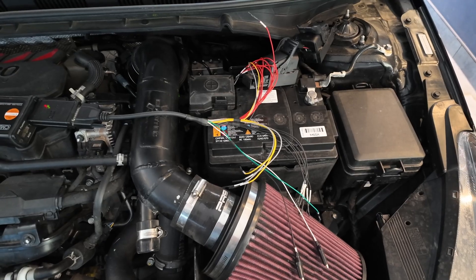The thing about this ECU is that it's quite similar to a Fiesta ST 180 but it's not identical — there are still a lot of things in totally different areas to what a Fiesta ST would be. It's actually a totally different ECU as well, but the actual structure itself is quite similar. I think there are things missing from the definition file I've got, which isn't ideal — I'm going to have to try and work with it to find everything I need. I've made a couple of changes over the last file I put on one of these, so hopefully that's going to be enough to give us the extra torque. I'm going to finish off a couple of little bits, then flash it onto the car and make sure it starts.